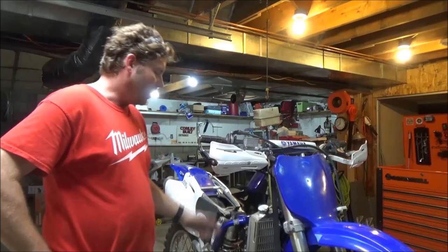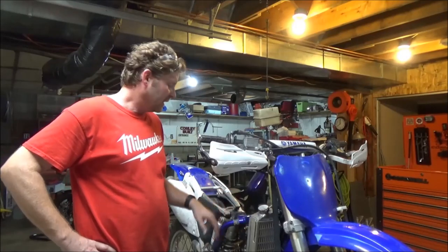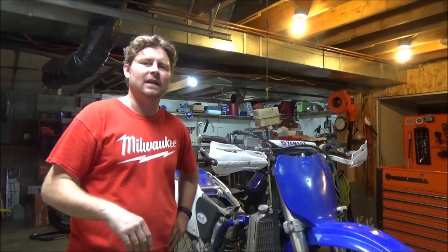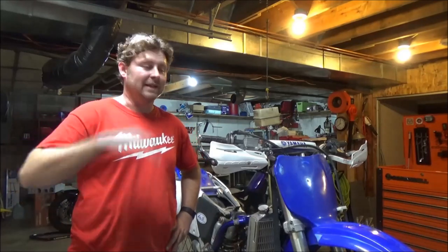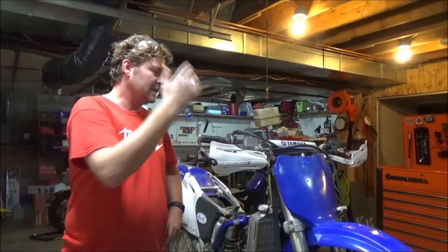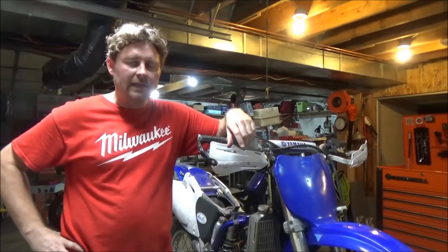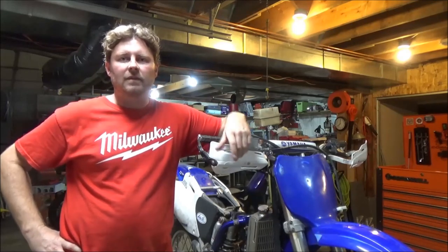On a decomp cam, you don't have to, but it seems to work pretty well. As I demonstrated in the video, do that top dead center compression, let it re-ratchet, and then kick it so you get a really good full stroke. Kick it fast — you can't kick this thing slow and be soft on it. You need to get it in the right position and give it a solid, firm, as-strong-as-you-can leg kick, and this thing will fire up. I've done this a half dozen times now because I want my customer to be educated on this too. I don't want him or her to be struggling when it's really just a lack of information on technique.